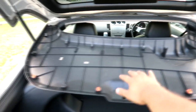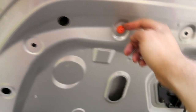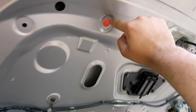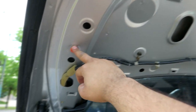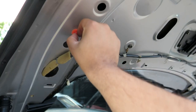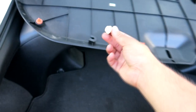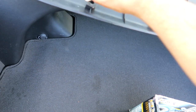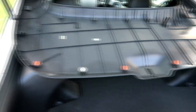It literally feels like you're breaking your car. There are also two clips at the back. If you're lucky you'll get all of these clips off cleanly — they just kind of slide off. If you broke these clips, it's not the end of the world. Before going to the dealer, I'd advise going to a pick-and-pull or junkyard. You can find these clips in door panels of Nissan models — these are off G35 door panels and they're the exact same. All you need to do is slip them on and now you have a brand new clip without spending five bucks at the dealership.